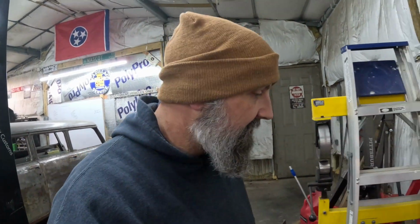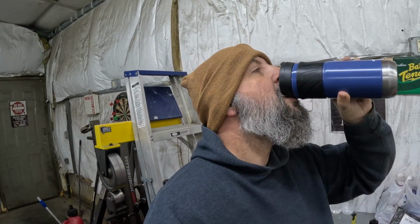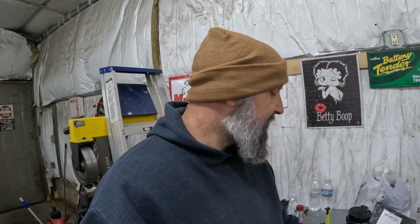That's Majic tractor, truck, and implement paint that we have. This paint requires a 24-hour window between coats. And everything that I've read or watched on YouTube says the same thing, that for best results, wait 24 hours. This paint mixes 16 to 1. So basically you got the little can of hardener for 1 gallon, the 1 can of reducer for 1 gallon. Obviously we'll have to cut those ratios to paint this car.